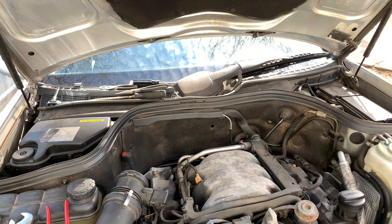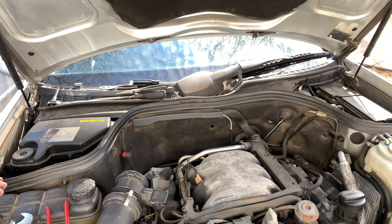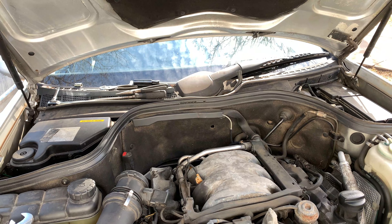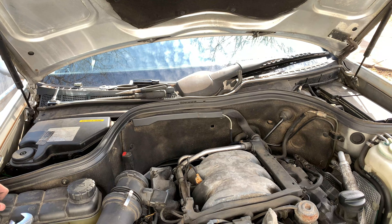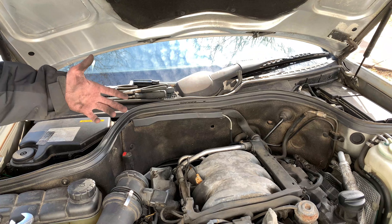There was a small hose that was corroded and still attached to the block. I don't have a replacement hose for that, so I just trimmed it a little bit because it had a hole in it, which was causing a vacuum leak. Trimmed it up, it got a little tight, then I flipped it and put it back — now it's on the block and on the EGR. That's looking good.